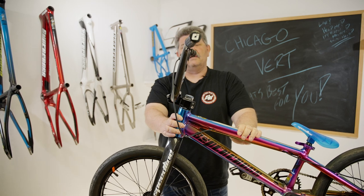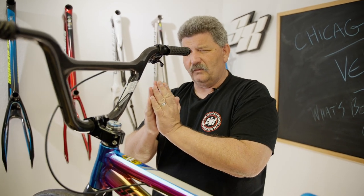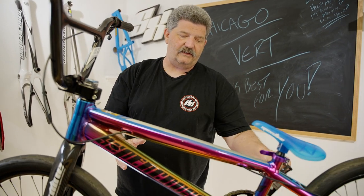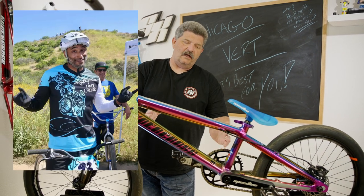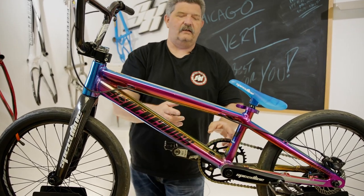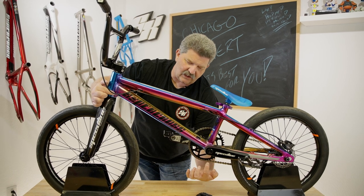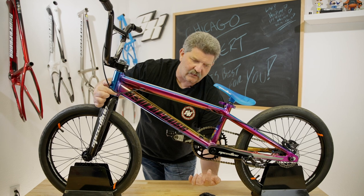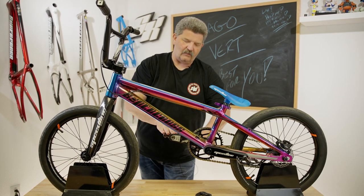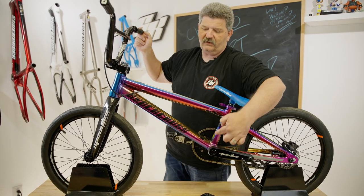There are a lot of videos out there about riding style and setup, but this is something you really need to pay attention to. Since we're talking about angles — when I was out at Dirty Fest talking with Dr. Jason Richardson about the way a frame rides, everybody wants to know rider area. But in the frame fitment video, I talked about how rider area is a false number because I can change it by raising or lowering the bottom bracket. You want to make sure you've always got a good setup from the bottom bracket spindle to your bars, so that positioning is always the same measurement.